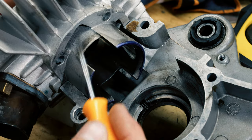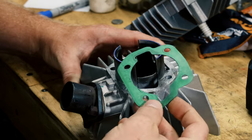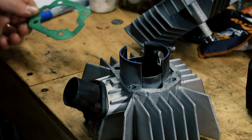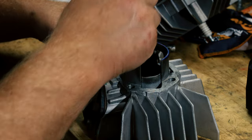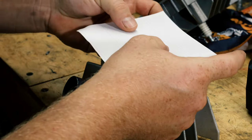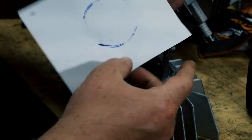First I'm going to create a base gasket for the cylinder and then I'll transfer these transfers to the case. These come with factory gaskets but they're never cut quite right and don't really line up, so I usually cut my own. To get this circle I usually use layout fluid, but you could use a sharpie or whatever you want, and then just press your paper on it. You get a nice circle, then cut that out.